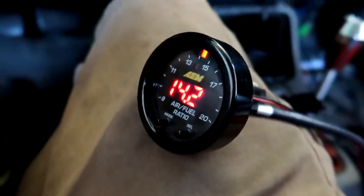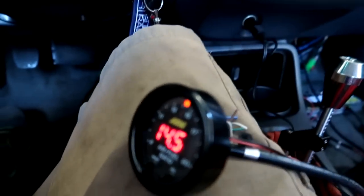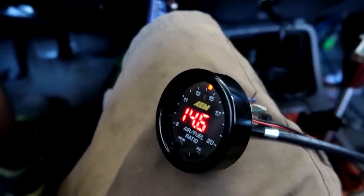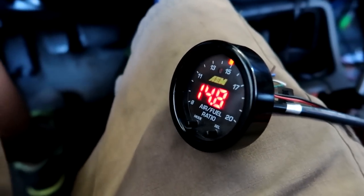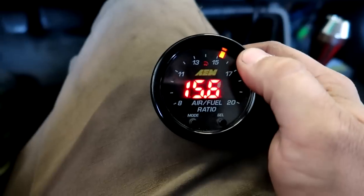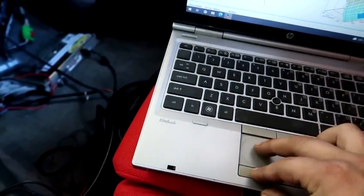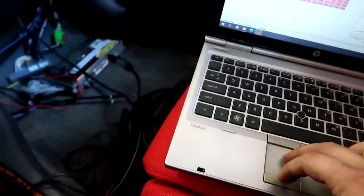Driving right now, making sure that the highway speeds are good for air fuel, map tracing, watching, adjusting. This is all looking really good. These injectors run like stock, guys. I'm telling you, they're super easy to tune, in my opinion. They work good. So we'll give it a little throttle here. We dip lean for a second, so we may have to splash a little in these columns here, just to kind of even that out.